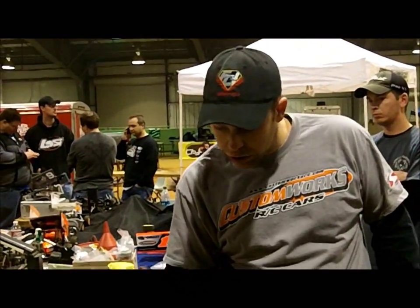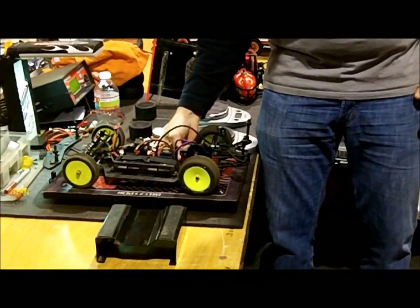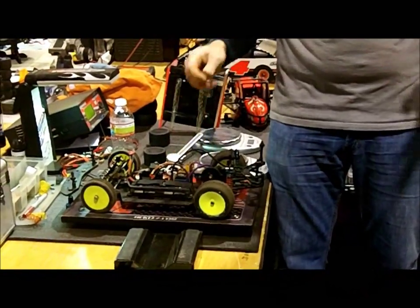That is what you're balancing. You're balancing your weights versus the attitude. And if one's at an extreme mode versus the other, the one at the extreme always wins out. And that's what I was talking about. If the car is much lower, overly low to the rear versus the front, it doesn't matter how much wedge or non-wedge you have in it. It's going to act like it's tight all the time.